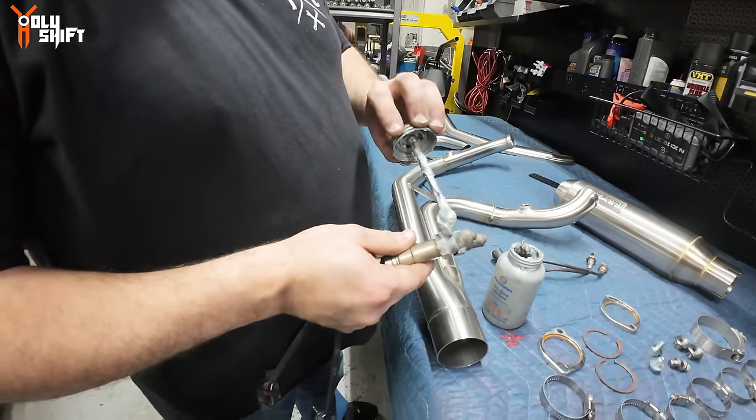The Loctite is based on the size of the bolt, if you didn't know. Red or blue, you mean? Yes. No, I didn't know. I thought one grabs more than the other. Well, Mike's got the big explanation on that. Hey, Mike, give us the explanation on red and blue Loctite. Blue Loctite should go up to a quarter inch bolt, or screw, whatever you'd like to call it. And when you get to a 5/16, it depends on the application.